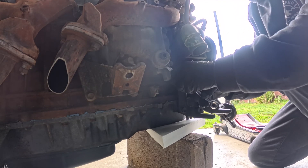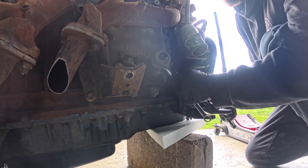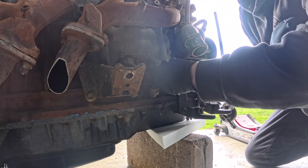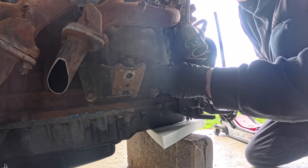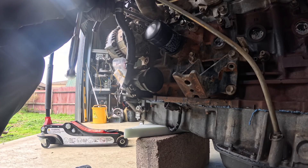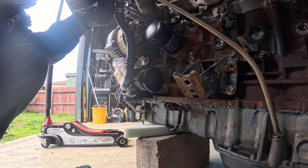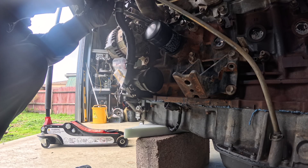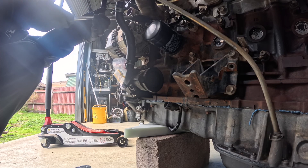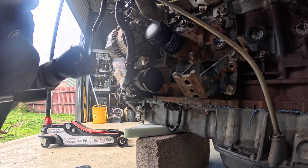It's good to have an old one to reference from. Once this engine's gone I can't exactly do that easily. There'll be two coolant sensors here — one is the gauge, which is fairly basic, and the other will be to tell the ECU when the engine's at operating temp and adjust the fuel mixture. I'm just going to snag both. It'll be the one with the single wire — but I'll take both anyway, just in case.